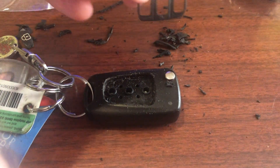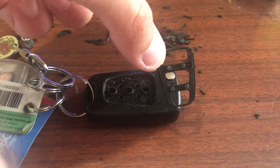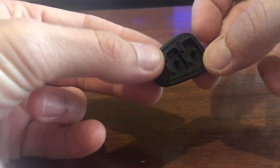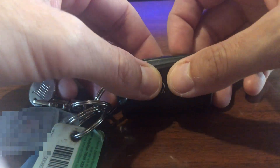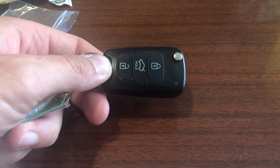Once the old rubber is removed and you're left with just the plain plastic surround — if you've cracked yours, you can glue it and it should be okay — get the new piece and put it around the frame. Start at the top or bottom, line up the little tabs underneath, and press in from the middle. You'll know it's in when you hear it snap. If it's not going in properly, use the tool to prise or push the section in.